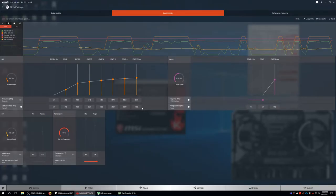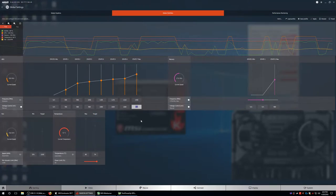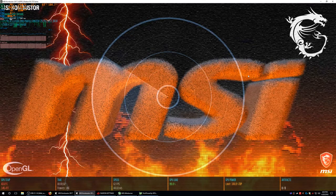So 900 mV is still my lowest at 1244 MHz. And at 1340 MHz about 980 mV was my lowest. So if we overclock, I have a feeling our overclock is going to be similar to before. If I go to 1450 MHz I should be able to get that, because I was able to get that before.